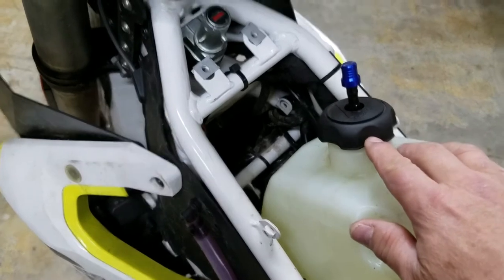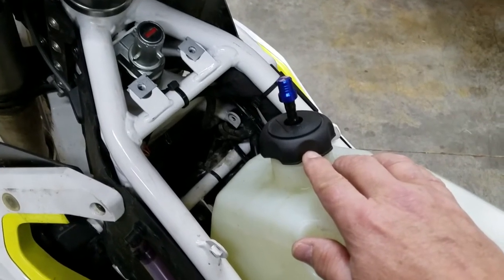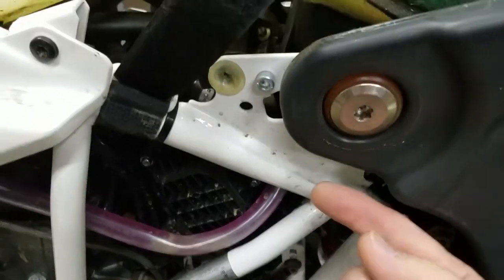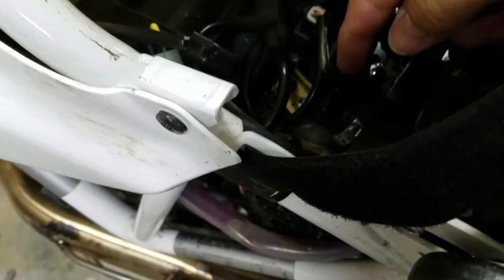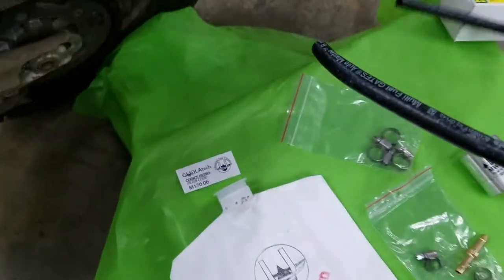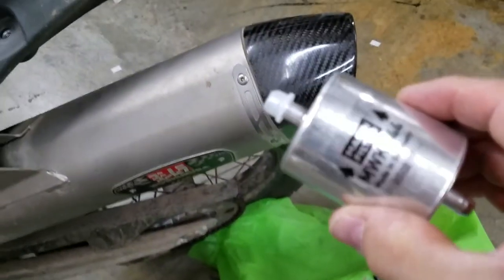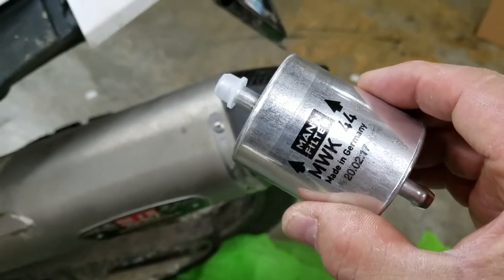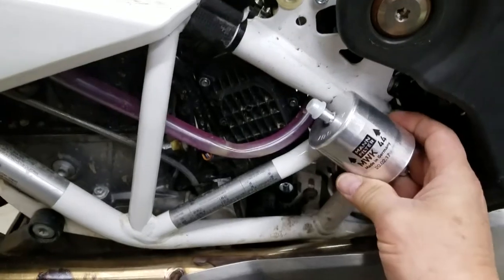We can insert a second fuel filter from Guglitech inside this tank — it just takes a different size, another product you'll need to add to your shopping cart. When the fuel comes from the rear gas tank, it comes down underneath. The fuel line goes up and finally comes to the front section where it goes into the injector. What we're going to be doing is inserting the auxiliary fuel filter inline before it ever gets to the fuel injector, with hose clamps for all the connections.